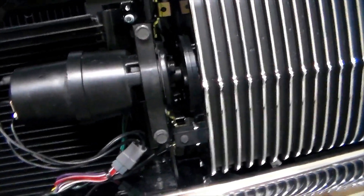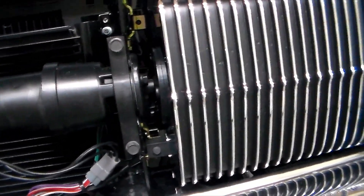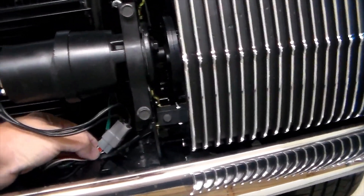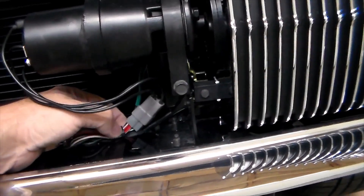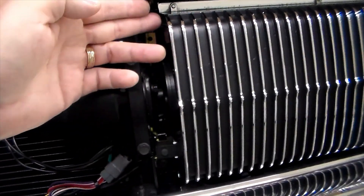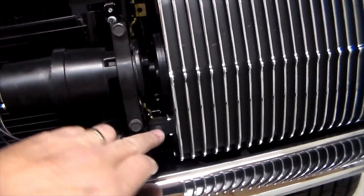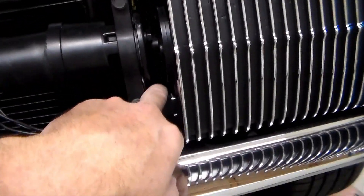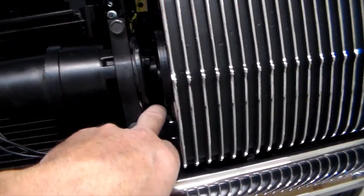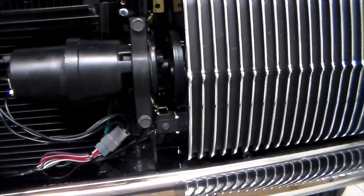You're going down the road, you pull over, you stop, you go to get out of the car, you shut your headlights off. When you shut your headlights off, current travels to the red wire. The red wire is what closes the door. This door is now in the opposite position - the door rotates down, and when it gets to the bottom it clicks the opposite switch, which opens and removes the ground. Then your headlights are off, your motors are off, and nothing's happening.